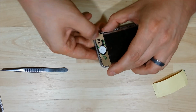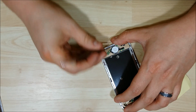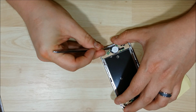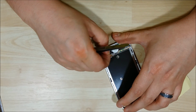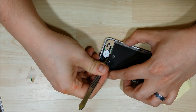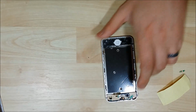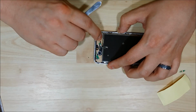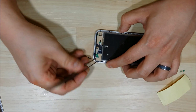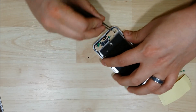Push it down a little bit and make sure that it's on there nice and well before I start trying to pry it off. I like to use a pair of tweezers to help me pull this up. Make sure to rub it down on the edge that you're pulling up so you get a nice even lift off. You want to make sure that the phone portion here is nice and level before you apply the adhesive as well. If you have any old residue when you first remove the LCD, make sure you scrape off all the old adhesive. That way you seat the new LCD screen nice and flush when we're reinstalling it, that we don't run into any hiccups as we go. Try to find an edge here that's put down nice and well that I can pull the sticker up with.